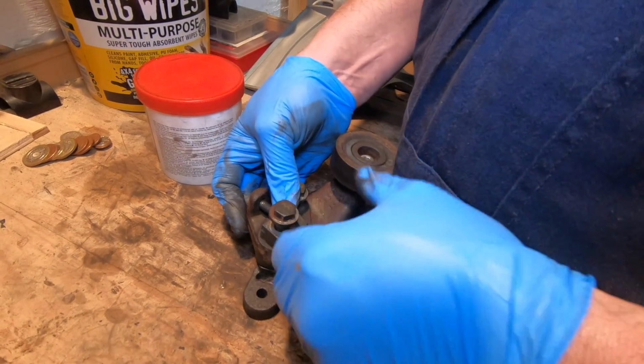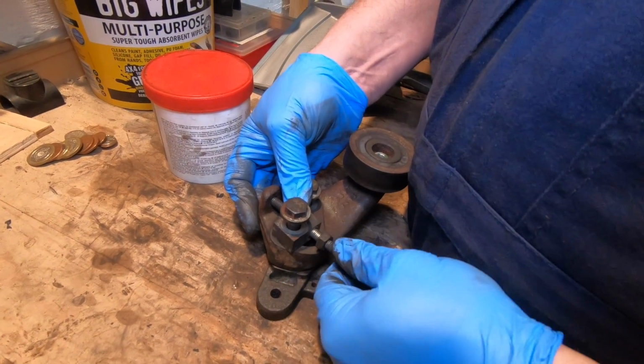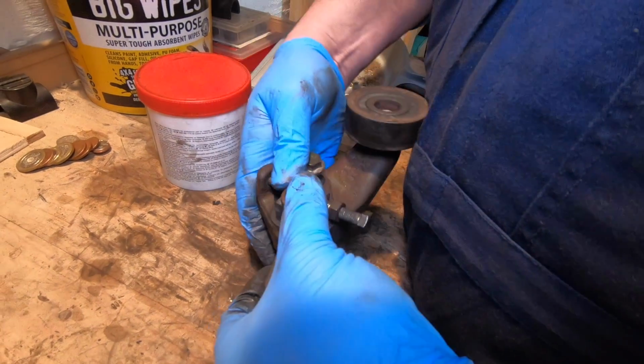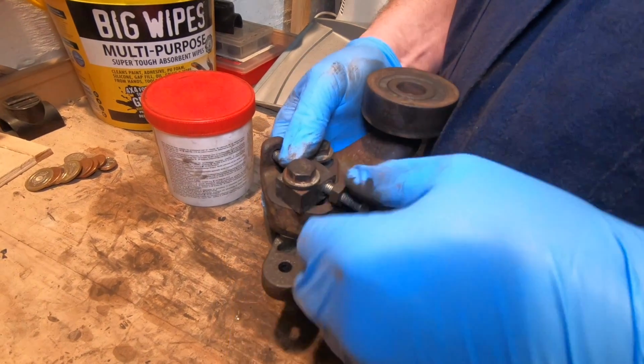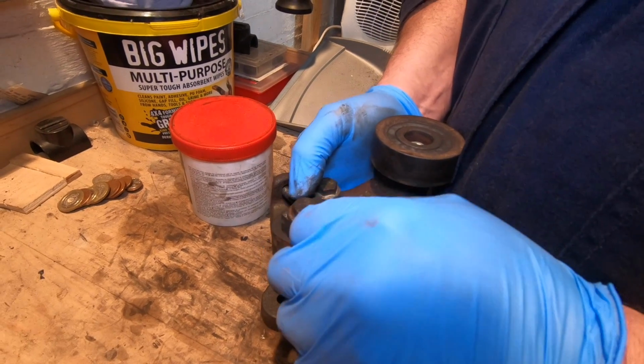And so you have these two nuts to lock it when it's in position. So if you screwed that screw in like that, see that's pushing that down? Yeah, it's moving. So you'd hold that one, turn that one, and that would tension the belt up, and then you'd lock it off. Yeah. That's the way it's working now.